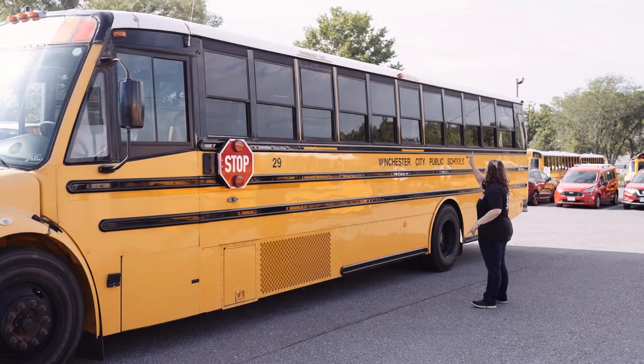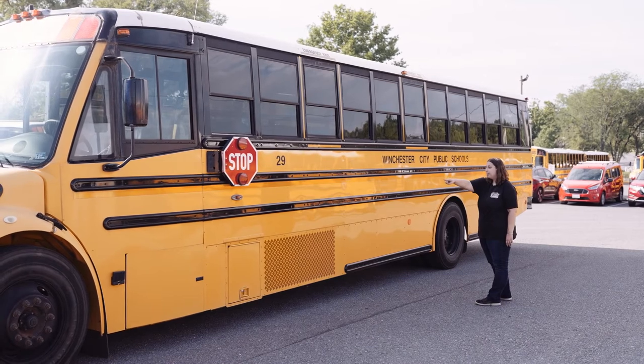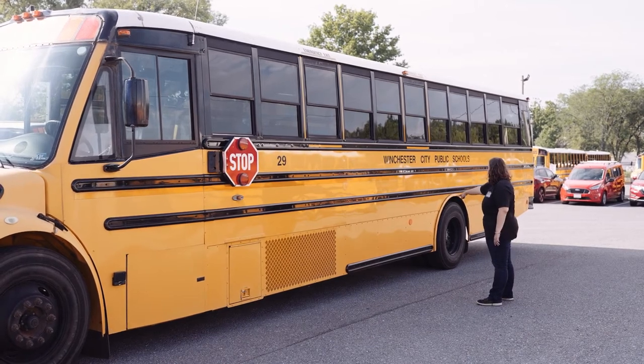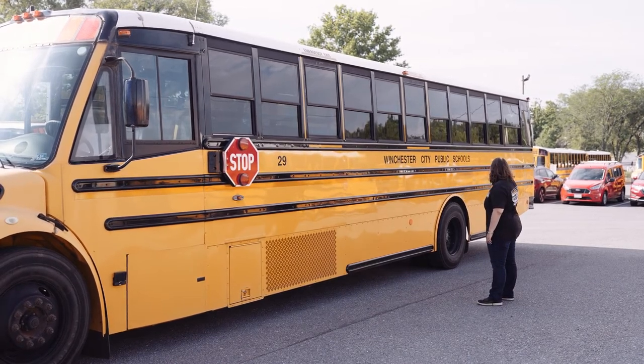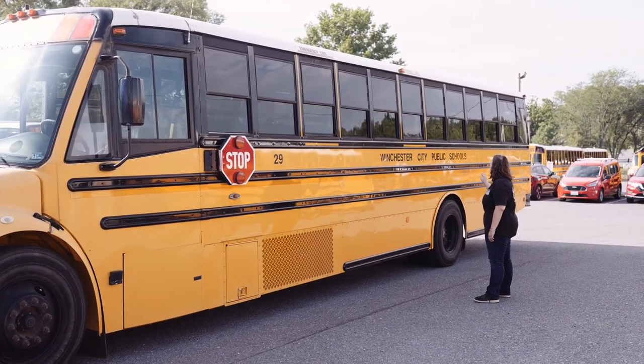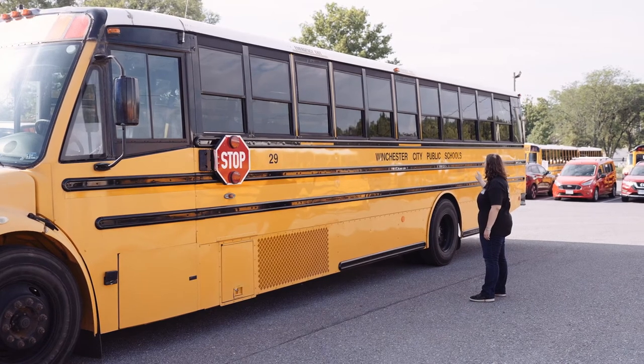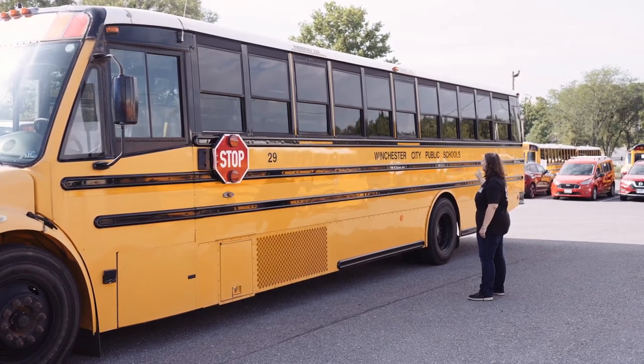I have 2 amber and 1 red clearance light, 1 amber turn signal, 1 amber reflector, and 1 red reflector. They're all not discolored or faded, not chipped, cracked, or broken. The seal's not worn, torn, or frayed. They're not missing any nuts, bolts, or screws, and there's no condensation.